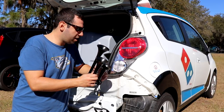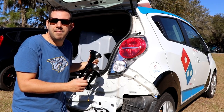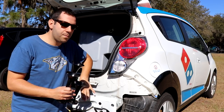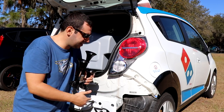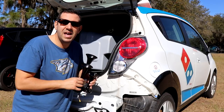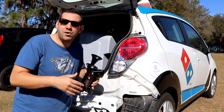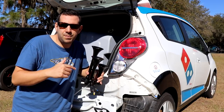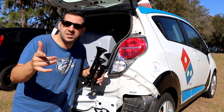All we have to do is run this air line into the cabin where there's a compressor. We're going to bolt these horns right to the rear bumper support where there are already existing holes from the factory, so we're not going to be modifying anything heavily. Then just run a few power and ground wires to it. The link to this air horn kit will be in the description box below, along with everything else you'll see in this video.